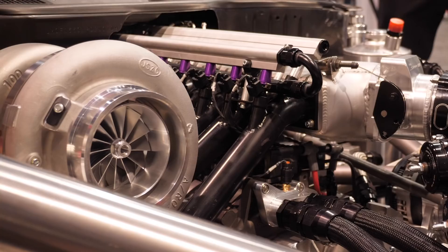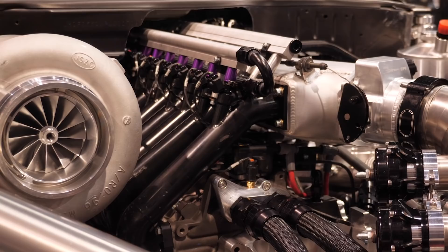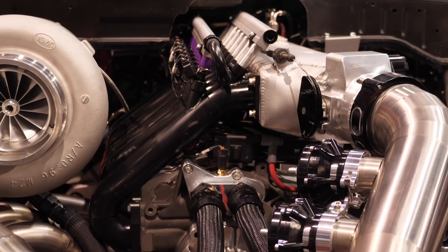For the fuel system, I started with a dual brushless fuel pump system with low and high staging — essentially a binary situation across both pumps giving me several flow levels. It's a Holley system with TI Automotive pumps capable of almost six gallons per minute flow. The brushless pumps have a speed controller for high and low fixed levels of fuel flow output.